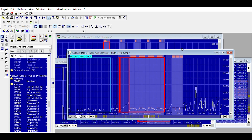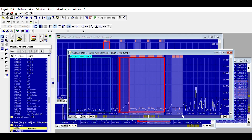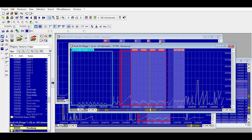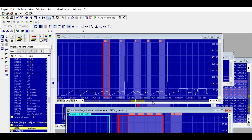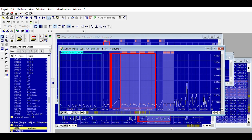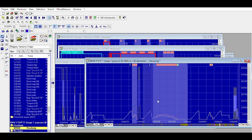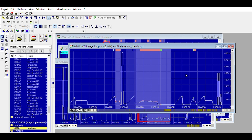And that's how you do a popcorn limiter. I hope you learned a bit about torque limiters and the importance of setting them in the right location for manual boxes. You can be a bit more flexible on automatic boxes. Obviously for stage two and stage three jobs with mapped gearboxes, you need to consider that as well. But for EDC16 and EDC17 — including for BMWs — it's all pretty much the same; you'll have the same kind of distinctive looks to them. Hope that helped, and we'll carry on to the next video.